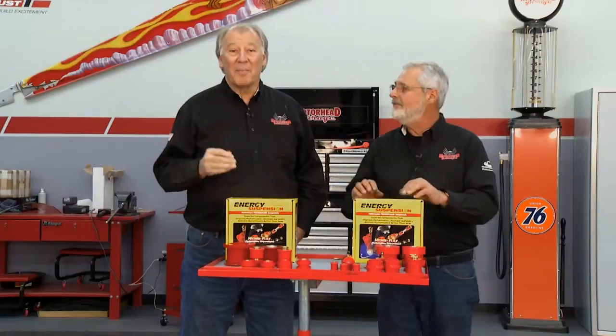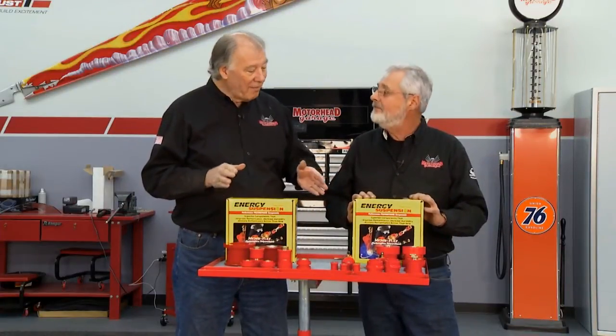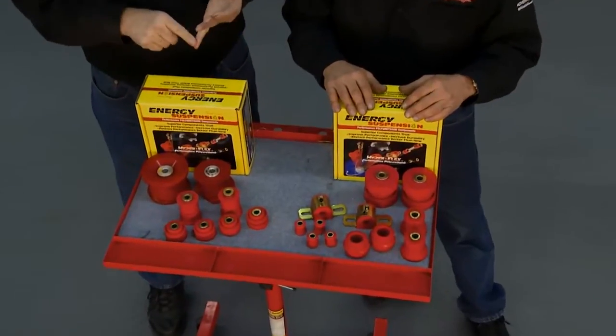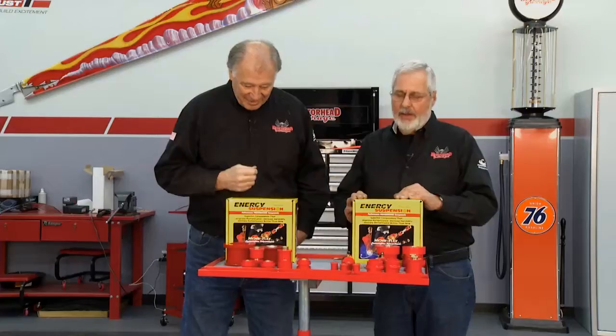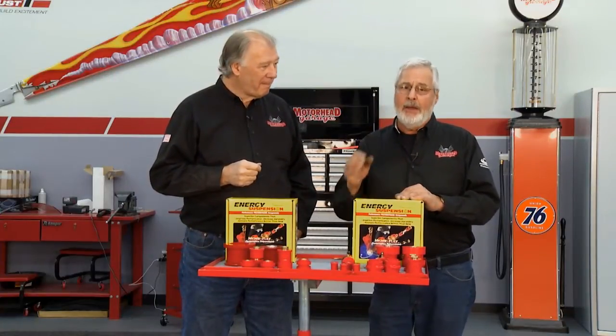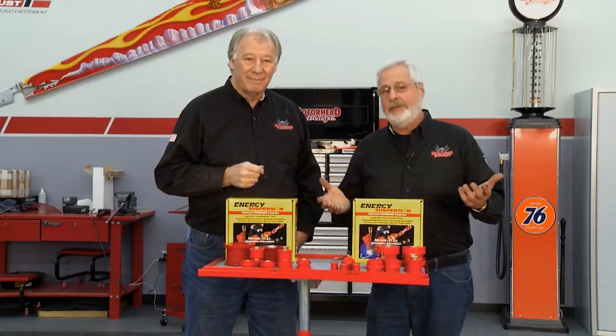On this week's industry update, we're featuring products from Energy Suspension. They got a complete line here now for the 2005 up to 2010 Chrysler products, like your Charger, your Challenger, your Magnum, those things. That's right. Those are great late model muscle cars. They're a lot of fun to slide around a track. But the stock rubber bushings are so compliant that they just wear out. You don't get consistent handling.